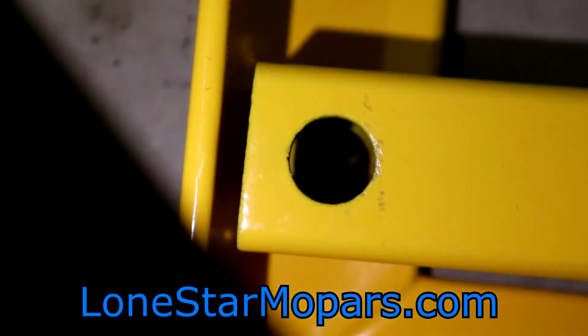We're going to shine down. You can see the concrete, right? And just trust me, that's about as square as we can get it. So when we come over here, you can see that line right there. It gets wider because we're not square. When you get to this wall, and you look down the hole, do you see all of that yellow? That yellow is there because this material was not cut properly, nor was it drilled properly.